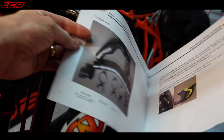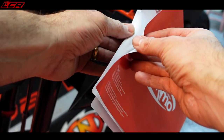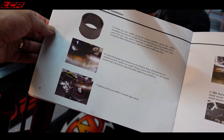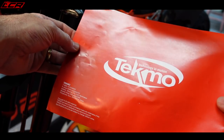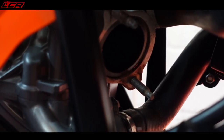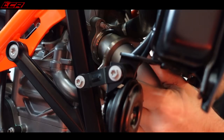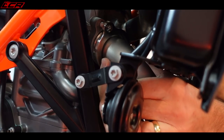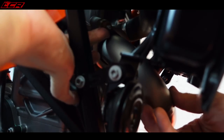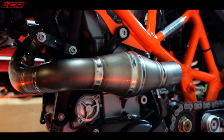Look at these for a set of instructions — it's almost like a brochure. Full colour, glossy instruction manual. I must say I am rather impressed with this Tecmo kit. It may not be the cheapest stuff on the market, but it's certainly got the quality. First thing to take note of: the lower bolt has a spacer — only the lower one — that's got to remain. The secret for this first stage is to just leave everything pretty loose. Make sure it's seated, don't over-tighten them. Leave it a little bit loose so you can move things around.